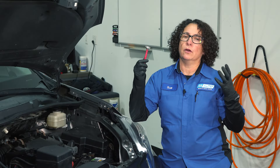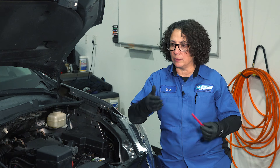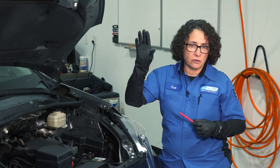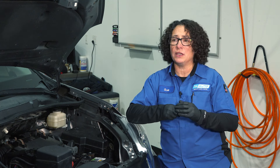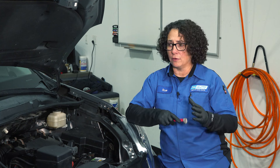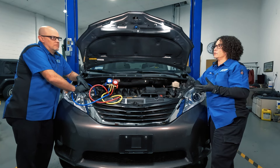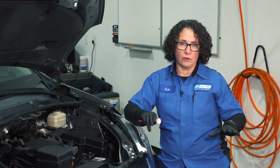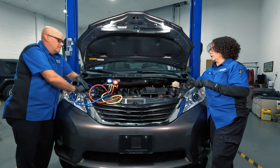So now you're like, this is crazy, it's a big job, you're thinking this is going to be a lot. Well, we're going to keep it simple. We want to talk about checking fuses, making sure you have power down there. To be safe, because any car within the past 20 years is going to have a lot of electrical possibility for damage if you back-probe things while the car is running with the battery connected — there are a lot of dangers in newer vehicles. So we're going to talk about how you can do it safely with just a test light.